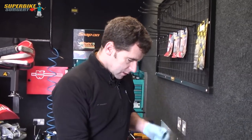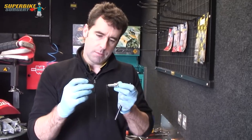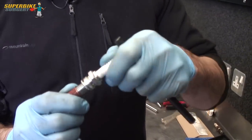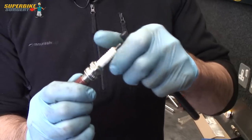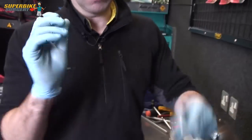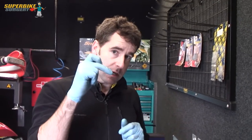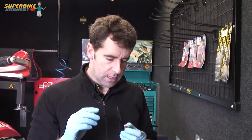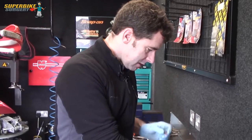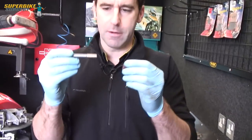So what does that mean for replacing your spark plug in the future - do you have to have a different size? No, exactly. The idea is, once the insert is in the cylinder head, the spark plug fits in a completely normal way. And the last stage of the process, once you've got your thread tapped in the cylinder head and the seat cut, the last step is to put the insert in. You use this tool - the insert tool screws inside the insert.